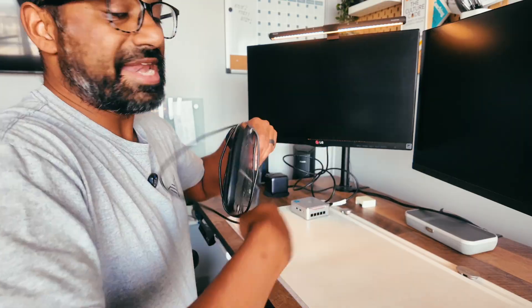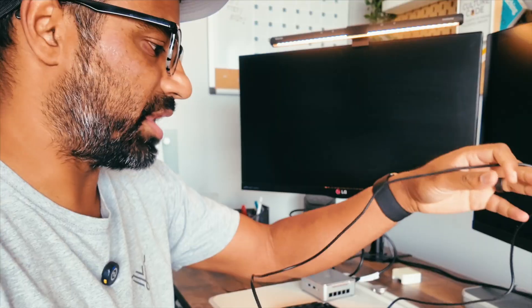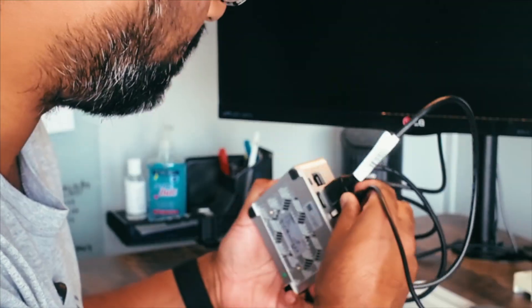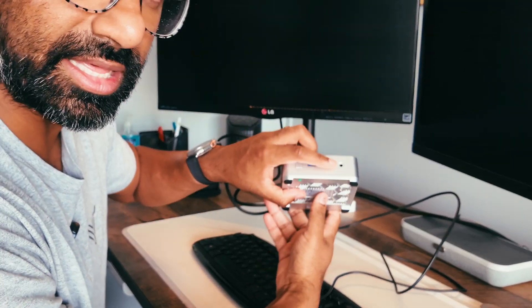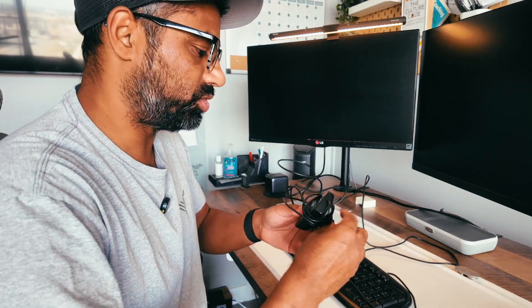I'm going to plug in the USB keyboard. As I mentioned, it does have Bluetooth so you can hook up a Bluetooth mouse and keyboard. However, because this is the first startup, I'd recommend using a wired keyboard and mouse — you can't even connect Bluetooth peripherals until you get into the operating system itself. The front has the high-speed USBs, so you don't want to plug your keyboard and mouse in there; you want to keep those front two USB ports free.